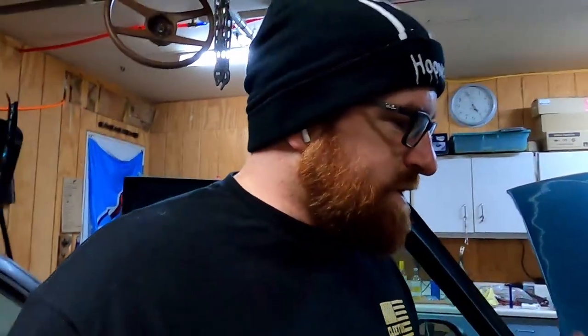It's pretty gross. But, you know, it's a good thing that we went on ahead and did this because now that carpet's not in there holding on to water like Rick Astley. And so hopefully it won't continue to destroy my truck. You can see a couple of spots where the paint's starting to bubble, where we're starting to get some rust. So what I'm going to do is dry all this stuff up and then go in there and hit those spots with the wire wheel and hit it with some of that rust converter spray. Spoiler alert, that stuff doesn't actually convert rust. It just kind of seals it and helps slow it down big time. But it's better than not doing anything about it. So I'll jump on that and show you when I'm done.